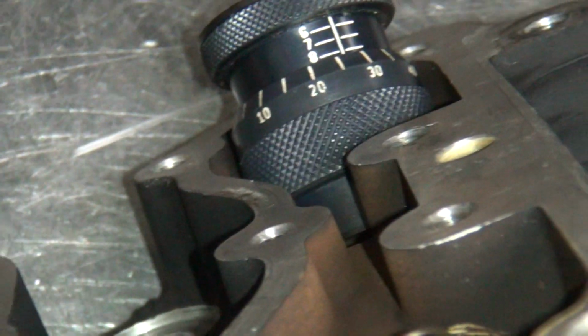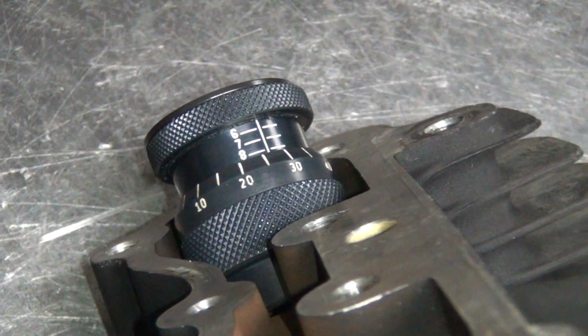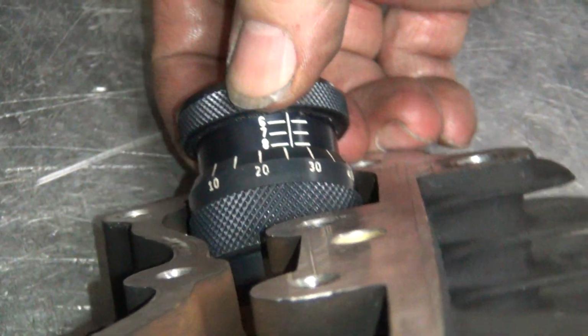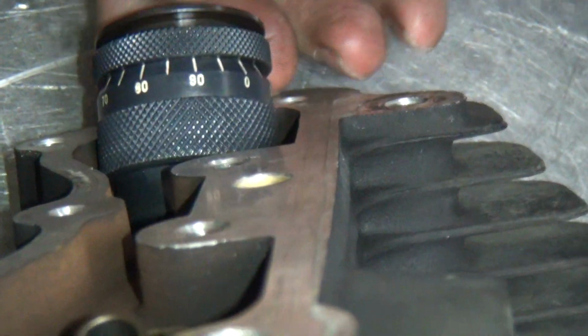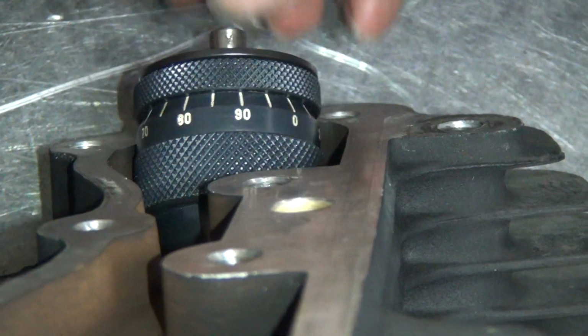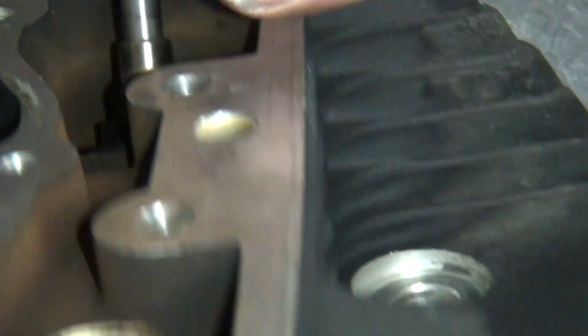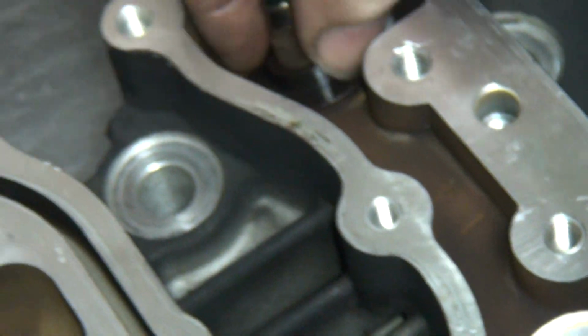And that was a 600 lift cam. We only got how much? 585. I thought we had to cut some off the stem. We have to shorten the valve guide a little bit, yes. On a normal bike, you would run into a seal to retainer clearance issue, because the guides are too tall. But other than that, there's plenty of room for a 585 cam. But most guys just put them in the air anyway. They don't care about the seals getting nailed, and they're not worried about it.